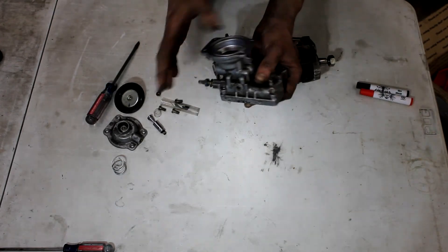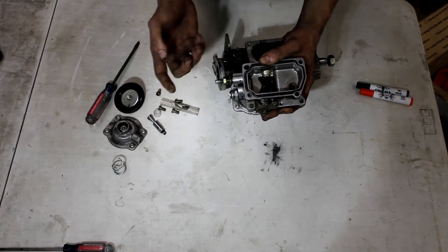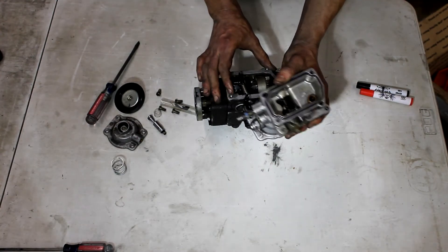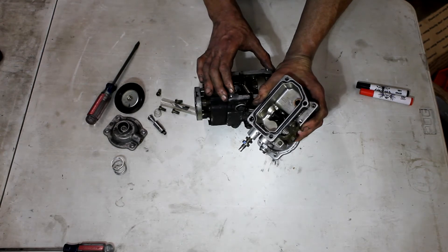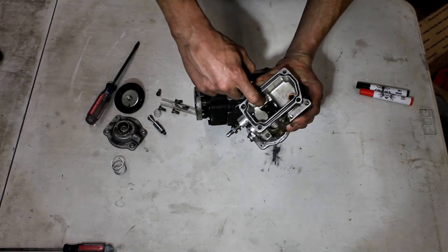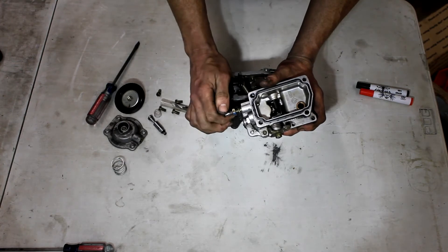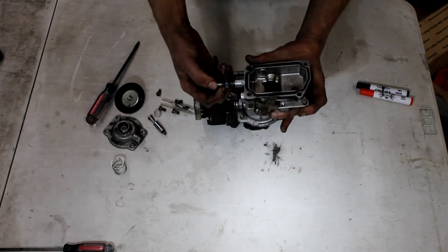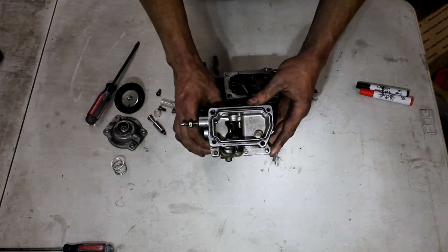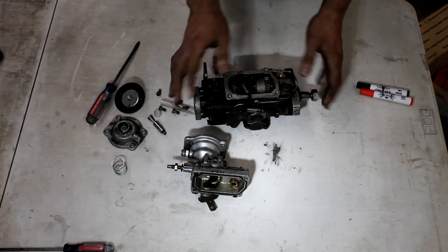This one has all the stops taken off because we set the idle with the fuel metering screw on this injection pump. Some say they've had to grind the pumps - Greg had to do his because this lever can hit on the hump inside the AFC housing. I've never had one do that. We can usually get these cranked all the way to where it wants to run away and then back off to a comfortable level. That hump right here is the one that usually has to get cut down if the lever is contacting it. You're better off doing all this work on the bench - much easier to keep material out of the pump.